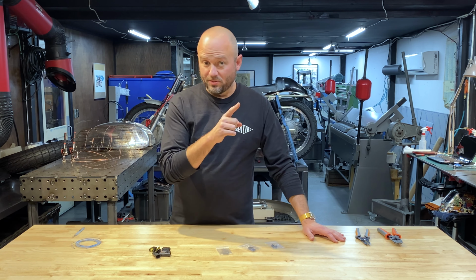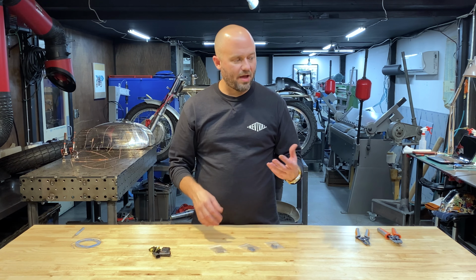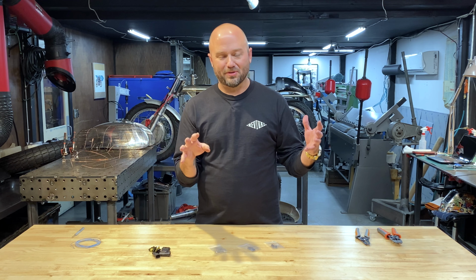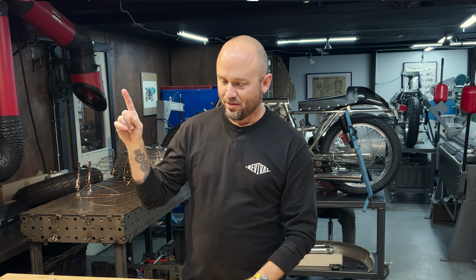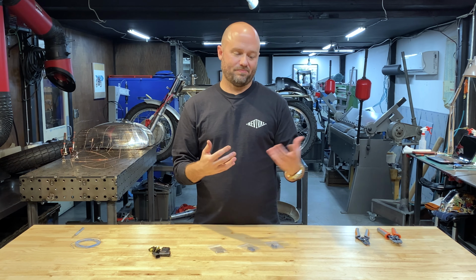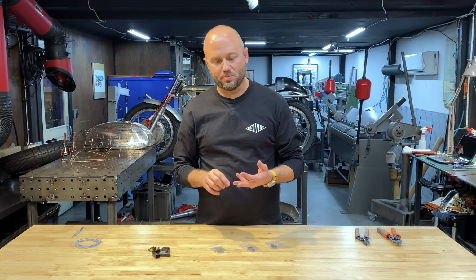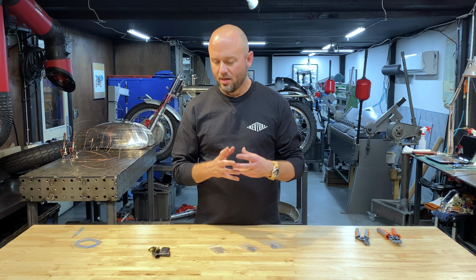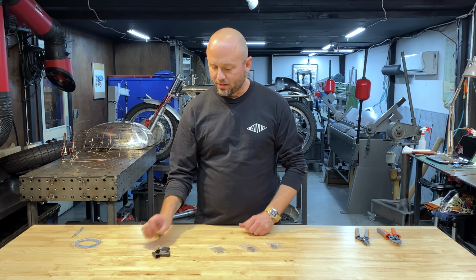Okay, so Mizu connections, that's what I was talking about. Now, in the past, I've wired motorcycles before and frankly just hardwired components. So in other words, run a wire directly from the fuse to the component or directly from the fuse to the switch, and forgotten the fact that I was probably going to go back at some point and have to service something, whether the switch goes bad, or the bulb goes bad, or even the entire carrier for a bulb goes bad. Sometimes you need to take things off, you need to remove it. Anyway, so you need plugs for that.